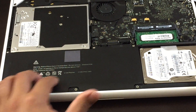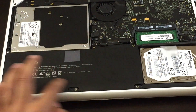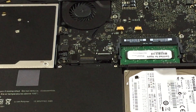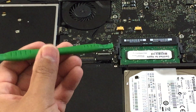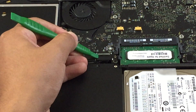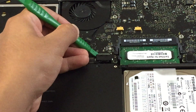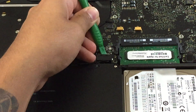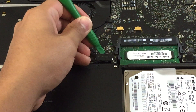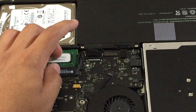One of the last things to check is the battery. This rectangular brick right here is the laptop's battery. To disconnect it, there's a slot right here. With a plastic tool like this, get right under it and disconnect it very easily — start from the edge and work your way around slowly. Leave the battery disconnected for around one to two minutes.